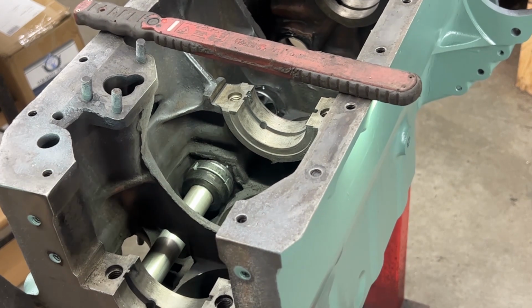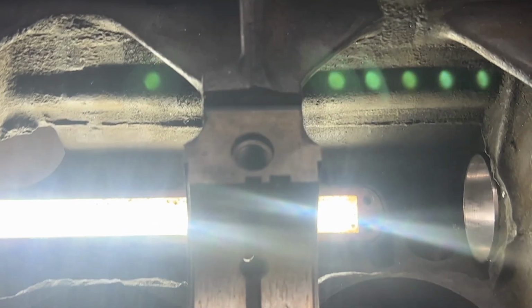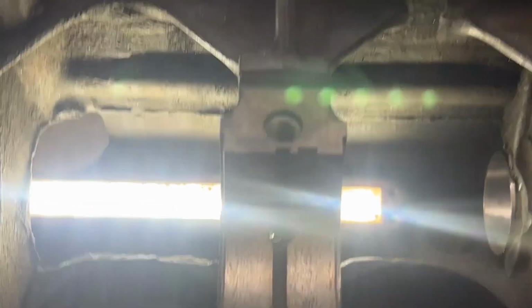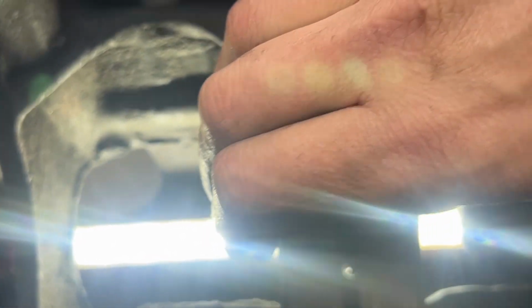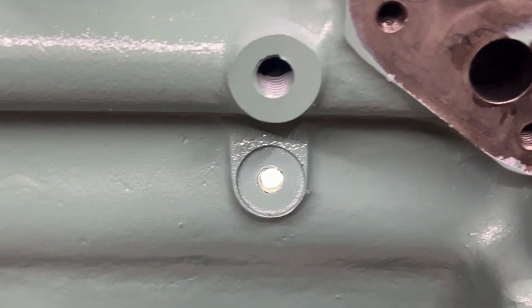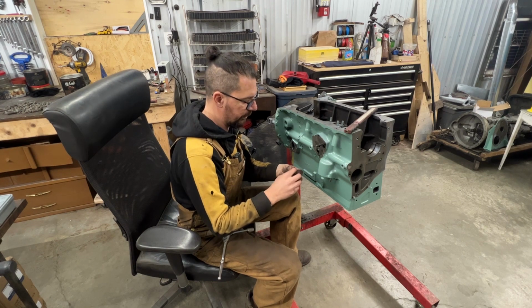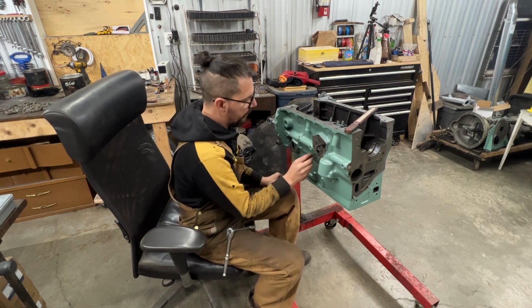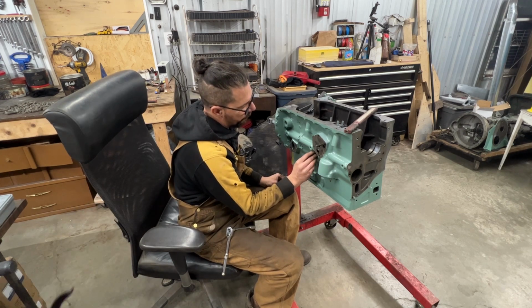Okay, that's better. I think we're perfect. I'm sorry about the light on the back, but you can see there the hole, and here too. So, perfect, we're done. All right, so now I can put the other two screws again, don't forget the special profile screws, and with that, our camshaft bearings are installed.